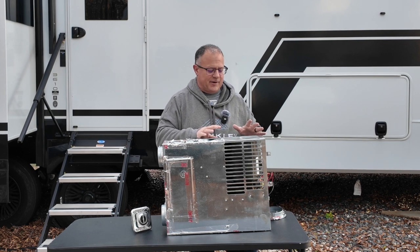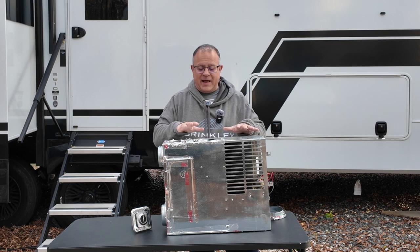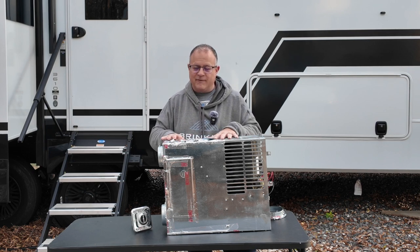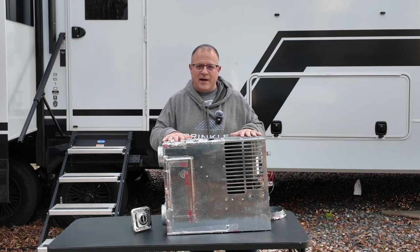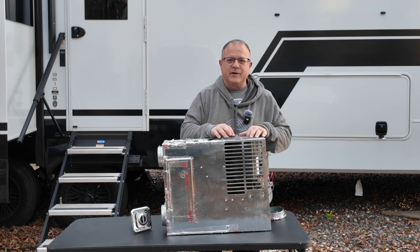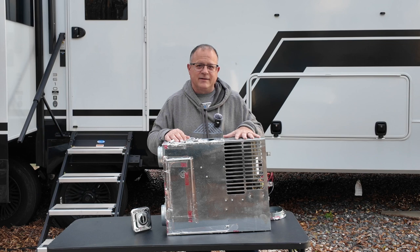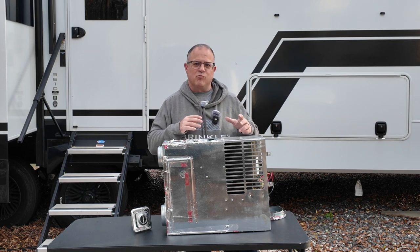In that scenario, the fan will just stop, but it hasn't had time to cool off the combustion chamber. So this is too hot. It hasn't had that safety time of the air flowing through here to cool it off. It's just abruptly stopped because it lost power. And this is so hot that without that airflow, it can melt and soften the fan. So now the fan has gotten soft from being too hot. Generally it won't melt, but it will make it more brittle.